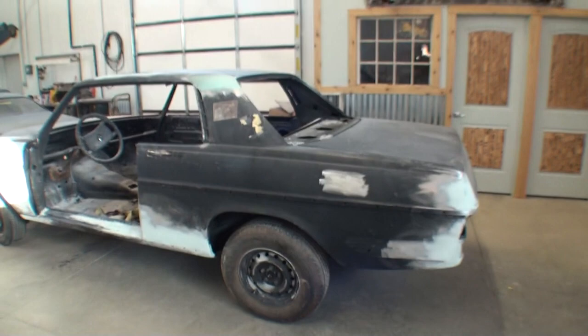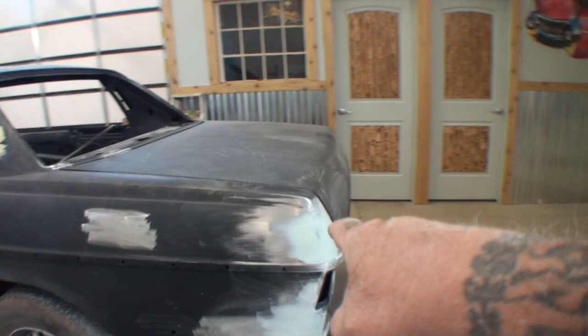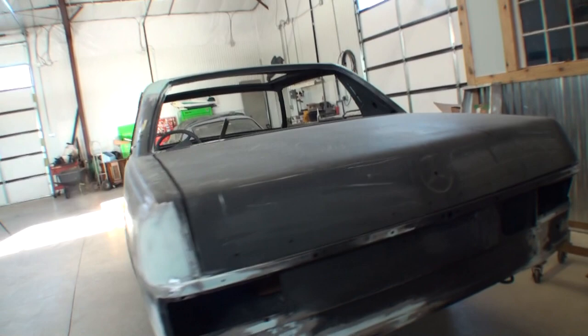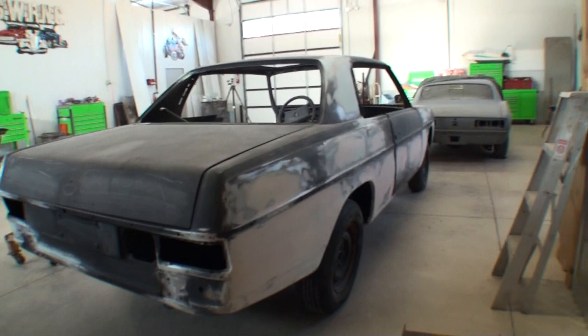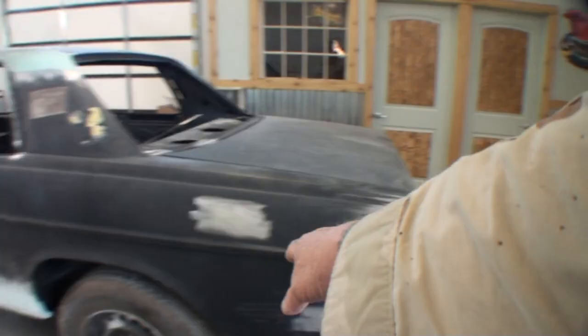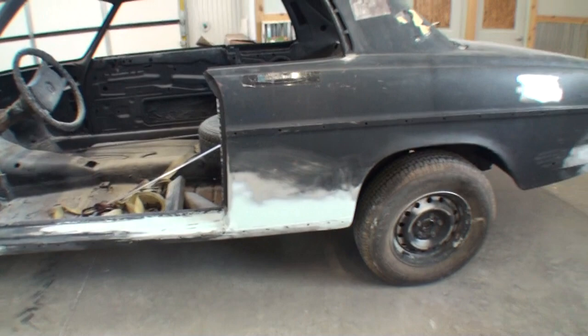It's a rear panel. We replaced this panel. It had a few dings on it, and then of course I had to mold in where we had to weld it together, because this is a seamless body. And when I say seamless, that means that when you look at the body of the car, not the doors and the fenders, we're talking about the main body, it looks like it's a molded one-piece body. We had to mold this in.